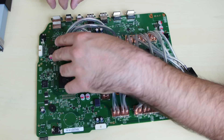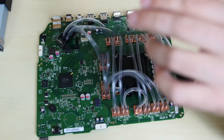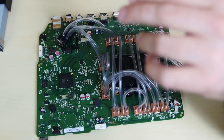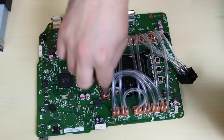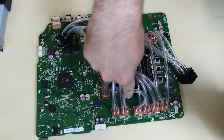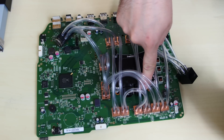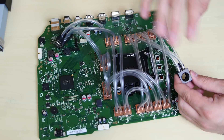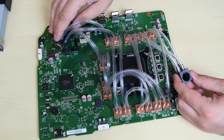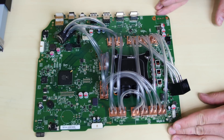That big cable is going to go back into the Xbox into the res pump combo. The res pump combo goes out to the radiator, and the radiator goes back into the Xbox. When it comes back into the Xbox it goes into this inlet of this water block, out the outlet, into this fitting, and then it starts the whole loop again — out of the Xbox, into the res pump combo. And that's how the whole thing is going to work.